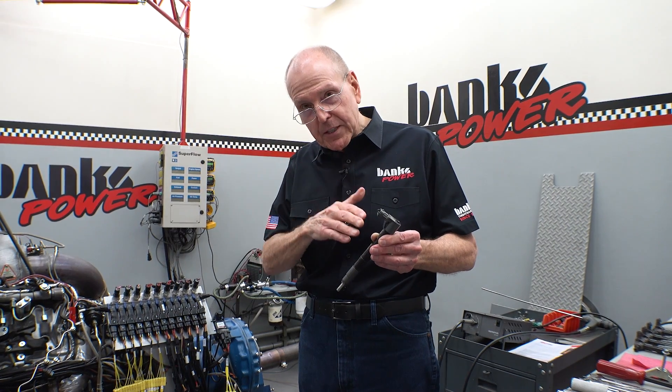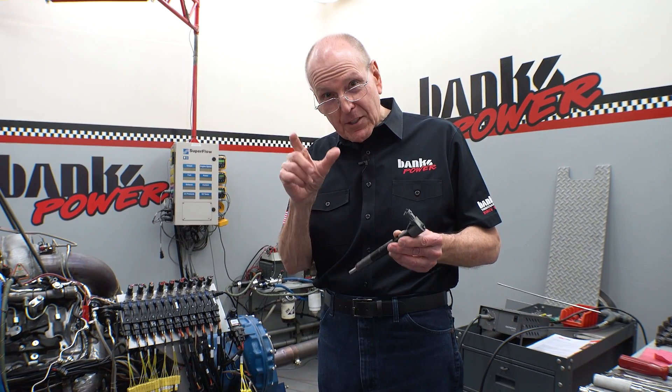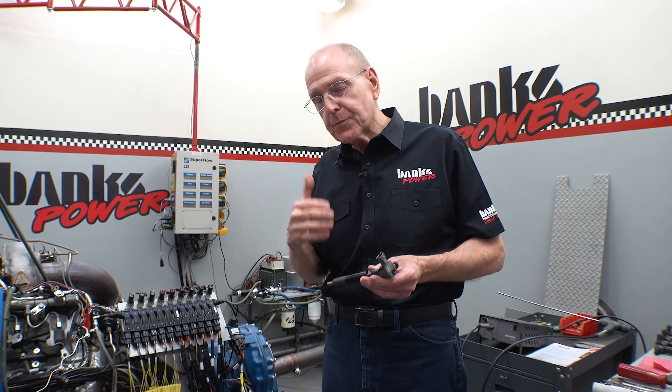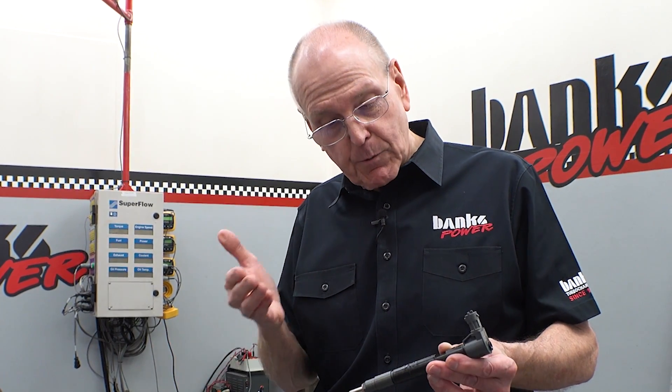If I want to inject enough fuel to make 711 horsepower but turn the rpm up to 3800 — which I do — then I need a bigger injector, because that crank rotation takes place in a shorter period of time. It takes a bigger injector to get the required fuel quantity in within the time I desire. I also want to pick up about 90 horsepower — my next step is 800 horsepower. Even if we stayed at 3300 rpm and made 800 horsepower, that would also require a larger injector because I need more fuel quantity and I'm already crowding 40 degrees of crank angle. So there are two reasons I need a bigger injector.